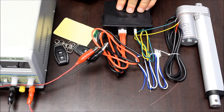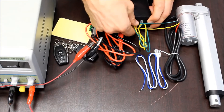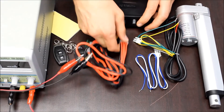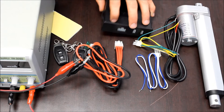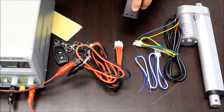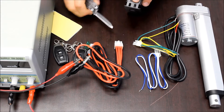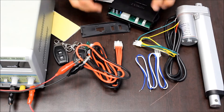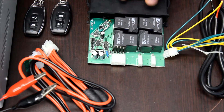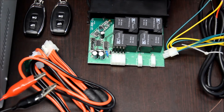Before you open the control box, make sure you turn off the power supply and disconnect the wiring harnesses from the front of the control box. Then, to open it, you need a flathead screwdriver or a knife to lift the tab on the side over the ridges so that the front panel will come off, and then you can pull the circuit board out. The circuit board may be very tightly wedged inside the box, so you may need to grip the front with pliers to pull it out.